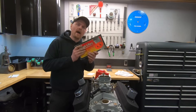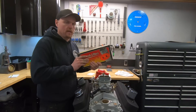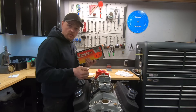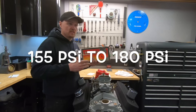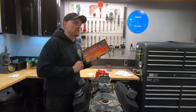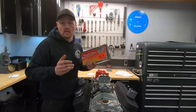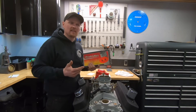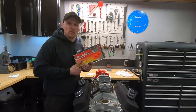So we know the idle side of these things work. They do increase vacuum as they claim, they do change the cranking compression, they change the sound of the idle — it gets a lot more mild. And they also tick a little bit, and that's a big complaint that a lot of people talk about: they sound almost like a sewing machine, sort of like a solid lifter sound.